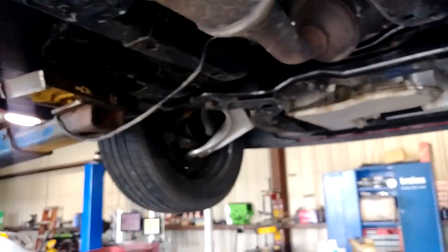This is something that needed to be fixed, so we might as well do some other stuff to it as well. We don't really want to take the rear muffler out because we don't want it to sound like a bumblebee or be stupid aggressive — it's a daily driver that gets almost 40 miles to the gallon. But we also want to get a little more sound, a little more power, and better fuel economy. Getting rid of this rear cat and resonator — where there's no O2 sensor behind the cat — is actually going to help with restriction a lot and allow it to flow better.